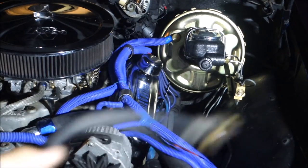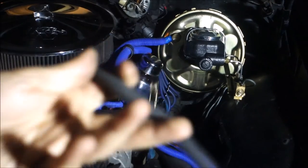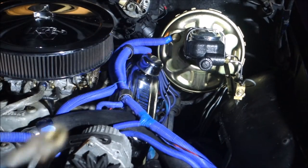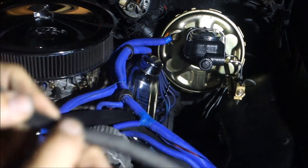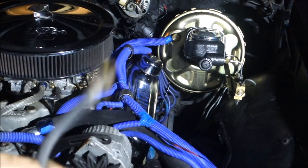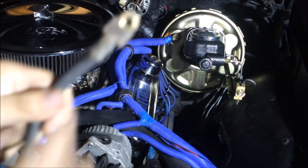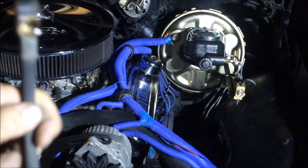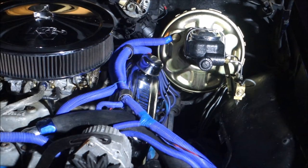This was the one hose I did not replace on the whole car. The lazy man and the cheap man always spend more money and work the hardest. The deterioration starts on the inside — it collapses, deteriorates, and becomes a big clog jammed up somewhere inside. That was the problem.